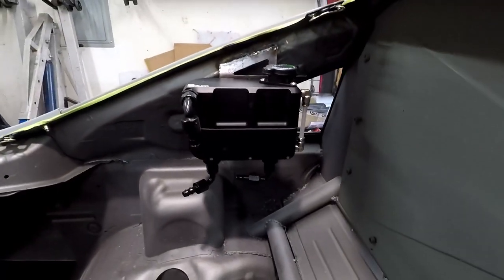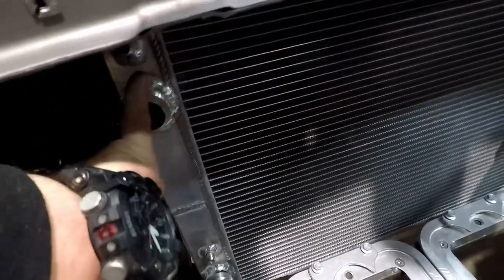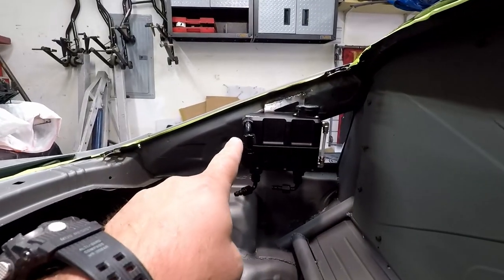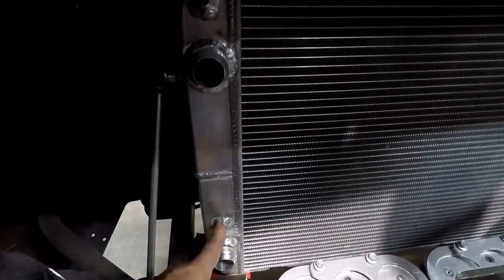Those dash 6 lines over here are going to come out of the radiator right from there. When the water comes in, the air bubbles and water will go up, pump out, and over to our swirl tank. The coolant will swirl through there, come out the bottom, and go back onto the suction side of the radiator here.